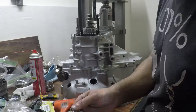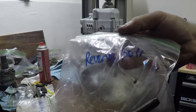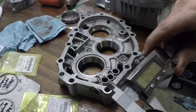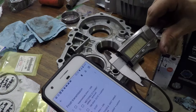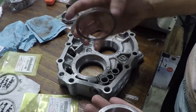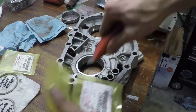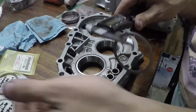We're going to throw on a light, thin coat of RTV just to make sure it seals up those imperfections, then everything will bolt together and we'll torque it to spec. We're going to throw in our reverse bolt as well — this is what aligns the reverse idler gear shaft. We'll double-check our shims, make sure we're taking the right ones. We've got our 0.046 shim and we're going to throw that in here. This one came straight from Japan so it's perfect. Our next shim, we'll double check — 0.048 — and with our notes that matches the 0.048 that we needed.